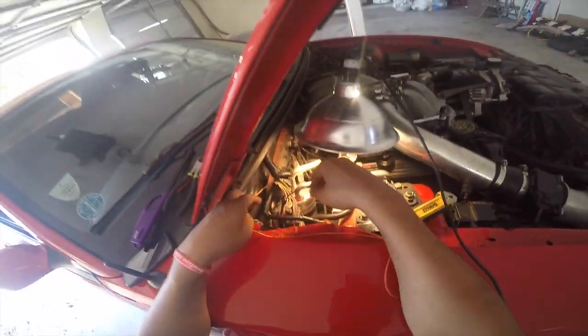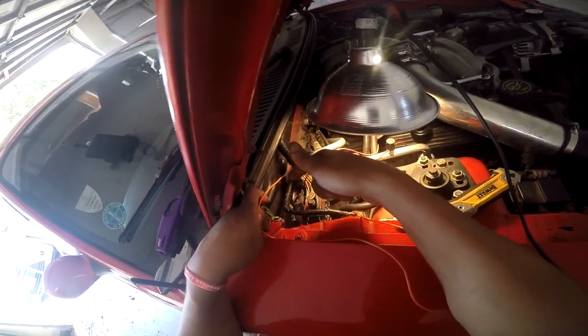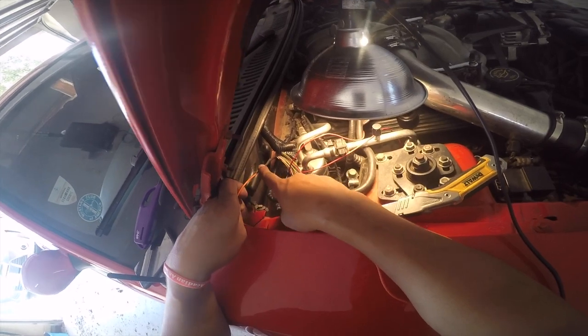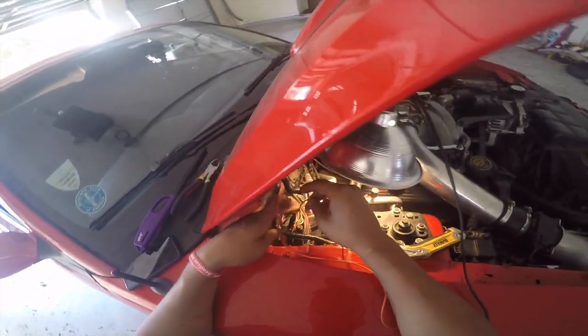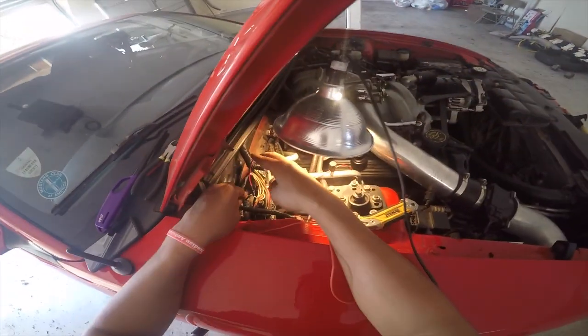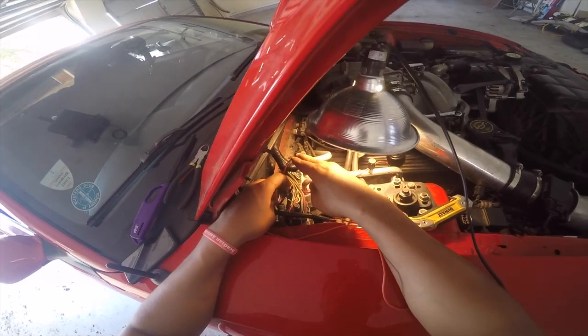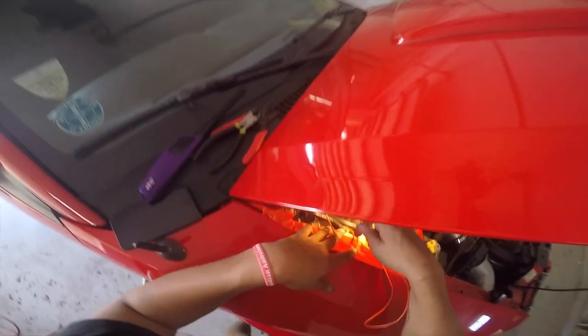Okay, so as you can see, I already got them wired, and in the instructions, this one, the orange one, they're referring to the black wire, but it's actually an orange wire. So this one's gonna go to the one that goes to the coils, and the red one's gonna go to the connector, as you can see. So this wire, the white and blue one, used to be together. Cut it in half, orange to the top, and then the red to the bottom, which is pin 34.